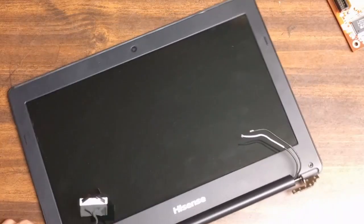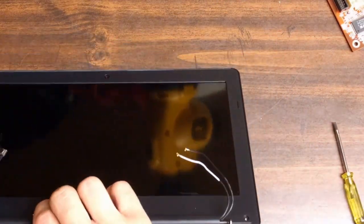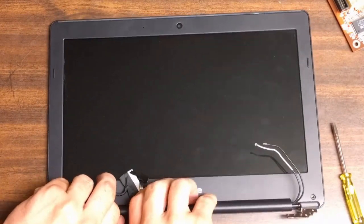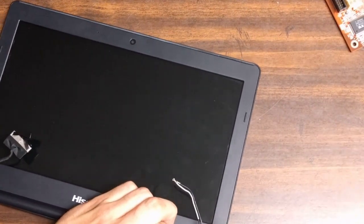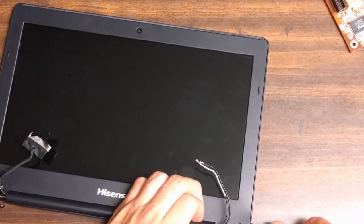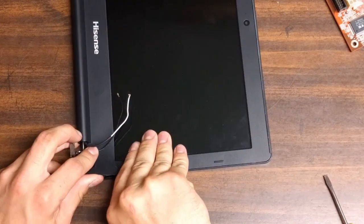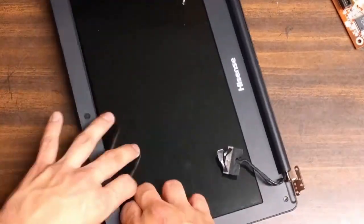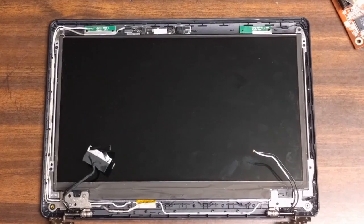So the first thing we're going to have to do here is take off this front shroud to get the LCD out, because I'm not going to be replacing the whole lid — I'm just going to replace the LCD. So the first and hardest step is getting that shroud off. You've got to get your fingernails under there and pry it up. Don't use a screwdriver like I just tried to do, because I almost scratched my screen — I did scratch that shroud. Thankfully I have the original one that came with the laptop. Once you get it unclipped, it comes off pretty easy.